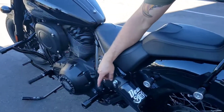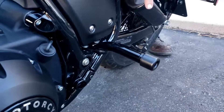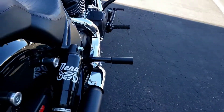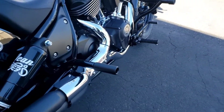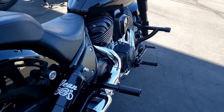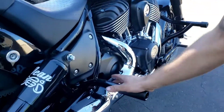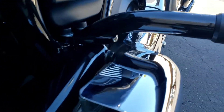Got a couple new parts I'm excited to show you here for our new 2022 Indian Chief. First off, we have our rear sliders to go with your front ones as well. We offer this with two options: we either have the inch and a half puck if you just want to use it as a passenger peg, or we have the four inch option which offers a bit more protection. These things are heavy duty — we use 3/8 plate and 120 wall heavy-duty tubing. These things are solid.